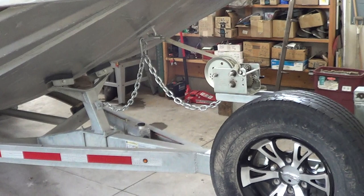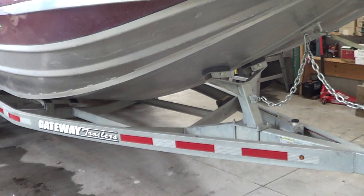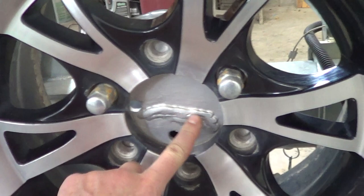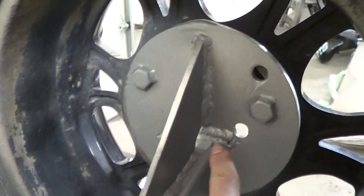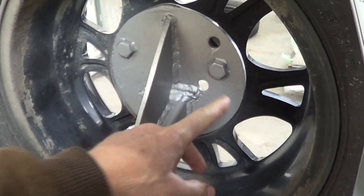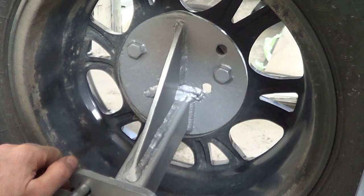With the trailer and boat, I doubt I've loaded it much above 6,000 — maybe a little over 6,000 pounds total — so it's definitely not overloaded. You can see where the spare tire holder cracked and I had to weld it there, and the same effect here where I welded across and added a gusset so it wouldn't break again. This failure is not unique to me — several friends have the same problem on the same hanger on basically the exact same trailer.